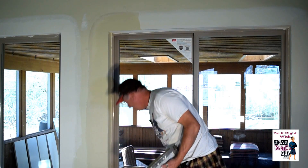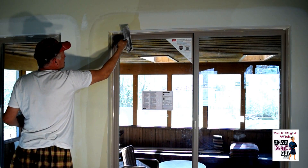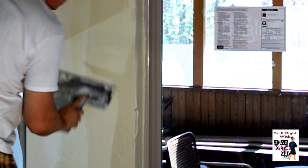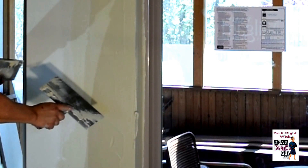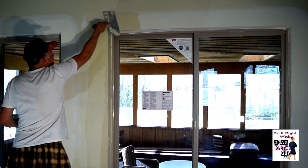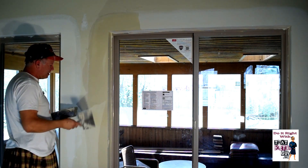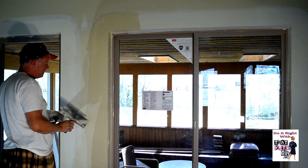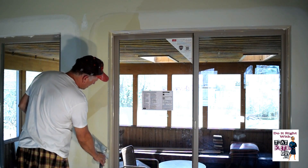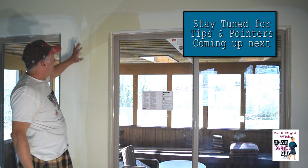You've done those two steps — you come out here putting medium pressure, trying to wipe the metal clean. You don't really want to leave a buildup layer, and you don't want to leave that metal buried because it can cause complications. As you come around here you're wiping it — medium tight for the second coat because you're not trying to put it on very heavy at this stage. That's pretty much what you want it to look like. Just go along here, pick up the heavy stuff, and the rest will sand off when you're done.